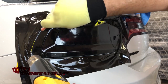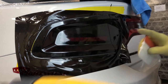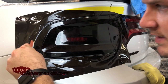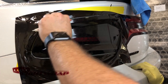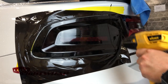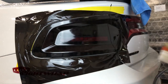Using one of my white squeegees — they tend to flex a little bit better. The goal is just to tuck the film all the way around the light and get a solid bond. This car has been repaired; these fenders and this rear bumper have been repainted, so this light isn't exactly where it should be. I'm kind of having to force the squeegee in there to get the film applied. Heat up around the edges to make sure the film doesn't lift anywhere at all.